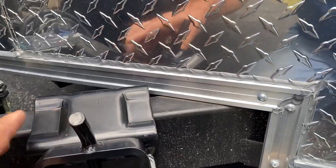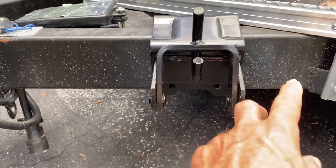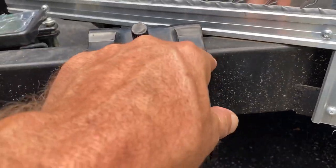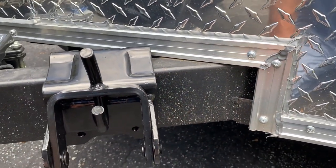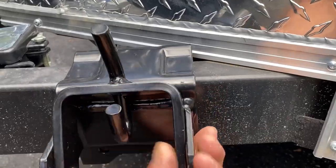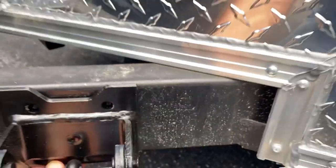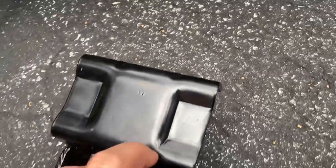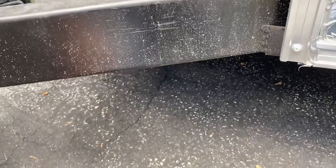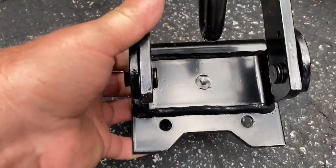Here's what I'm talking about — it just fits over like this and then it hits the side of the trailer. From the torsion bar to this point here it's too short — at least two inches too short. So what I'm gonna do, as I said, is cut that, just have a flat bracket, and it'll slide back to this point here where I can measure to give me at least an inch or more to play with. If I turn this upside down you can see how far back it slides — from this point here back over here. Once I cut this top part off it'll fit flush against here.